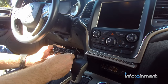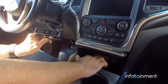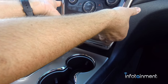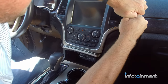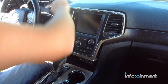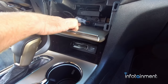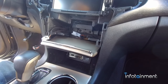When using Apple CarPlay and Android Auto, you need to replace your media hub, located in the cubby. It's very easy to replace - just a couple of T15 Torx screws hold it in place. Remove the bezel just like before, going around the perimeter. Once you remove the bezel, you'll see two seven-millimeter screws. Unplug the connector and remove those two seven-millimeter screws.